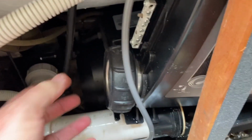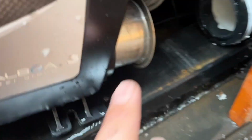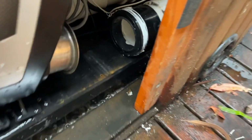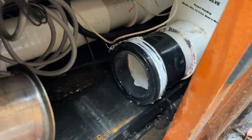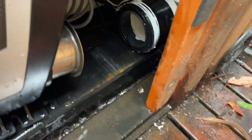We've got a situation here with a controller. It's certainly not very old, but these controllers have what's called a split nut on the end. It's because they've got this raised edge on the heater, so they have a split nut to get the lock nut over it. It looks like this. What's happening with this one is either it's been done up too tight or it's got a little bit hot, but it's actually clicking as you do the lock nut up. It's click jumping over the thread and keeping going.